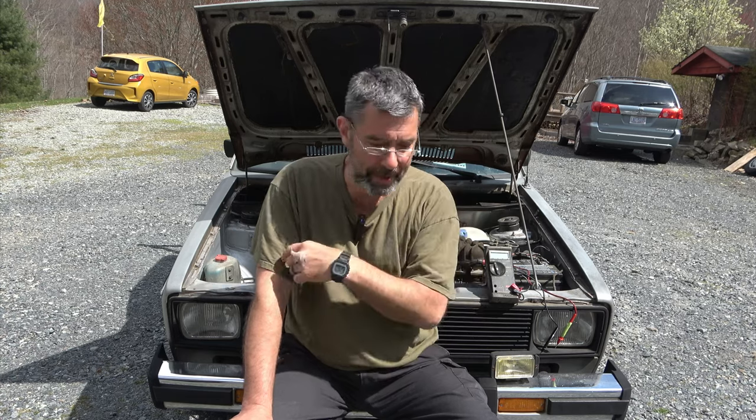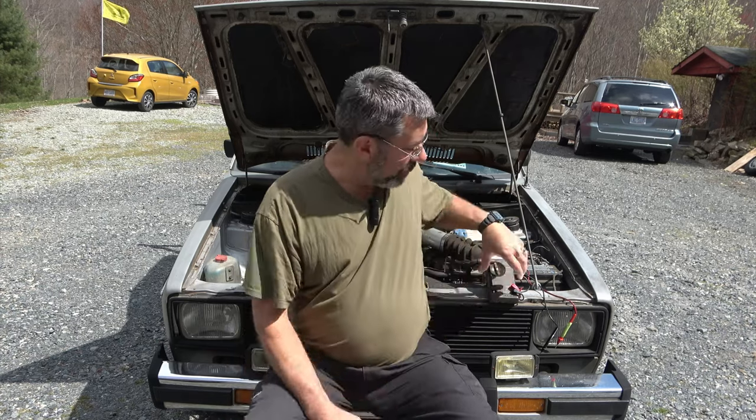I figured I'd make this video since I'm about to do it for real. If you ever had a car that you drive and drive and drive, park it over a weekend, and when you come back out the battery's dead — recharge it, drive it all week long, no problem — then leave it over the weekend and come back on Monday and it's dead again, or sometimes just overnight. That problem is called a key-off draw. That is when you take the key out of the ignition and go in for the night, and something in your car is still powered up and causing the battery to drain.